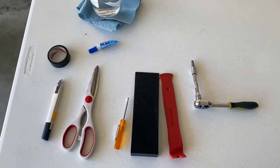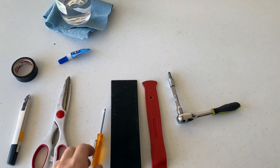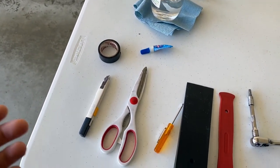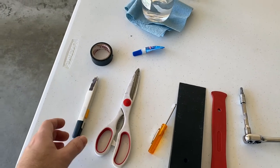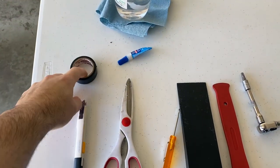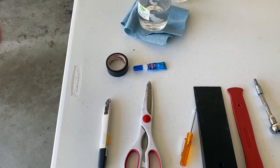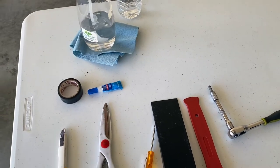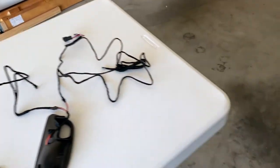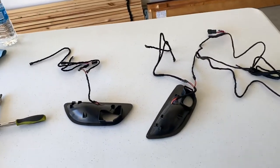This is all you need, at least so far. It's a T30 to remove the screws that hold the door panels. These are some trim tools to remove the plastic trims, a small screwdriver for connectors, and something to cut cable ties. I had to use a little knife to cut away one of the original holders that's been glued on. Some electrical tape to tape down the wiring inside, and glue because one of the little clips broke. Rubbing alcohol to clean gluing surfaces - and as a side note, the alcohol also works great for mosquitoes.